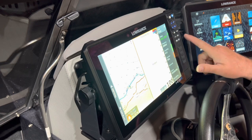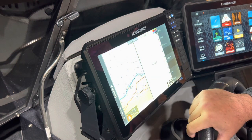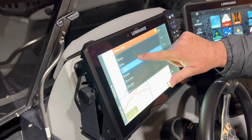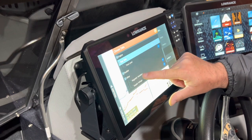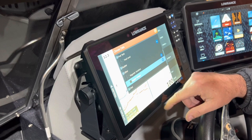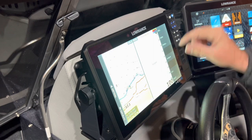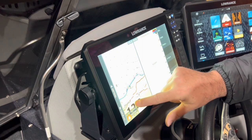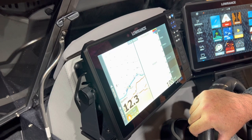Active Target I have to turn on — hit save. I'm going to hit power. I'm going to edit overlays and hit add. The first thing that I do when I select an overlay — the most important thing to me — is supply voltage. Check mark and you'll see it pops up at the top. From there I can drag and drop it wherever I want. I traditionally always have it in the bottom left corner and I make it as big as possible, because when you're running four or five graphs it's important to be able to see your supply voltage.